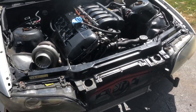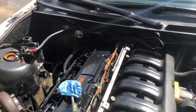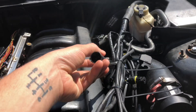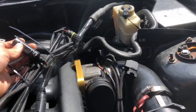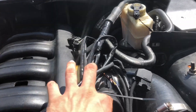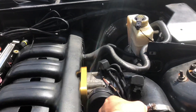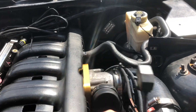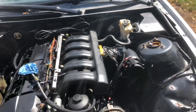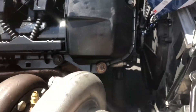Super excited — progress is moving along. I'm going to button more things up. Pretty much all the wiring is done. There are a few leftover connectors: two are for secondary O2 sensors that won't be used, and one is for a primary I'm not going to use. One of the long wires goes down to the oil pan and still needs to be plugged in. Other than that, the cooling system is bled, everything's good, and everything's plugged in.